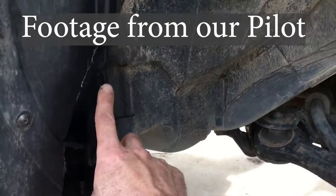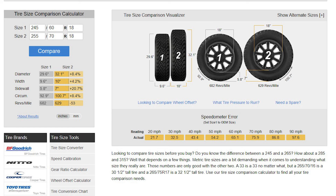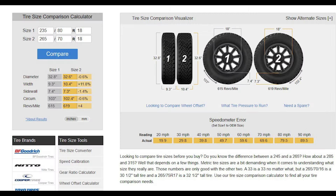For transparency, I am planning on running a 32 to 33-inch tire. Both these tire sizes will require trimming of the wheel well and cutting some metal on the back-end side of the wheel well. I'm planning on following guidance from John DZ and others who have gone this route before me — I've been told that with a little bit of bravery, it's not impossible. The stock tire size of the 2024 Honda Passport Trailsport is approximately 29.6 inches in diameter. The first and most common 18-inch wheel tire size that could fit is the 255-70R18, approximately a 32.1-inch tire, which nets us a little over an inch of lift.